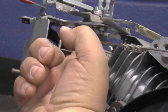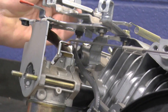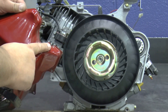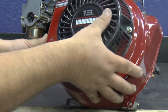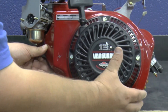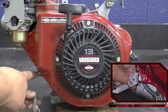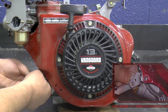To avoid interference with the throttle linkages, route the spark plug wire in its correct place, then connect the plug wire to the spark plug. Install the starter shroud, making sure the plug wire fits inside the cutout on the shroud. Install the lower left mounting bolt and bracket — the bracket has a protrusion on the back that must fit into a slot on the engine block. Torque the bolt to 84 inch-pounds.